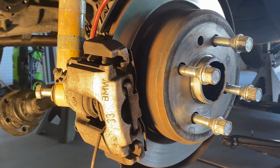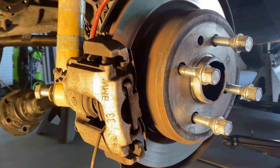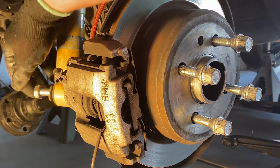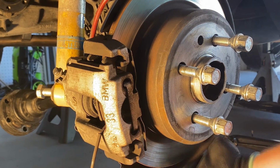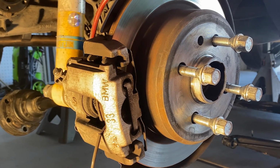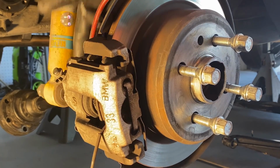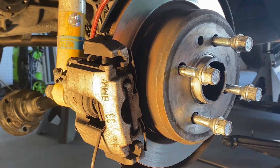Next, what we want to do is there's a 17 and a 17mm. So we just want to disassemble these 17mm. I took off this, I believe that's a 19mm. What you want to do is support the trailing arm with a jack, take off the preload, then disconnect. Then you can make access to everything back here, which will make removing the axle a little bit easier. So let's go to a time lapse and show you what's going on.